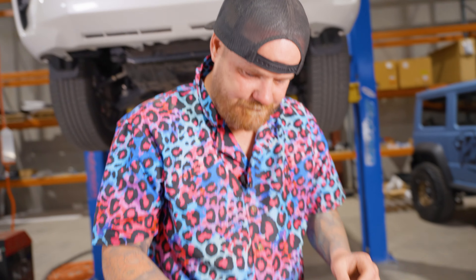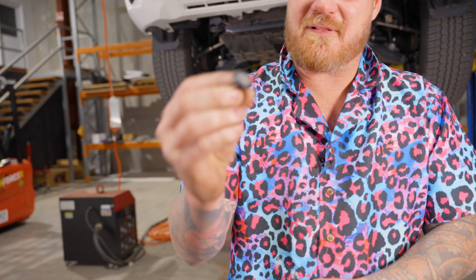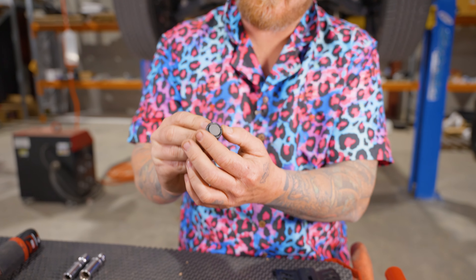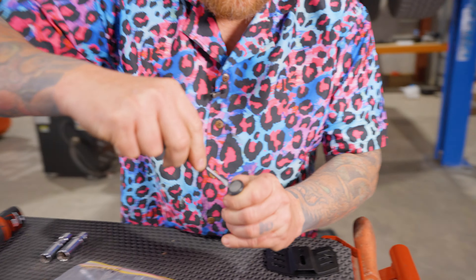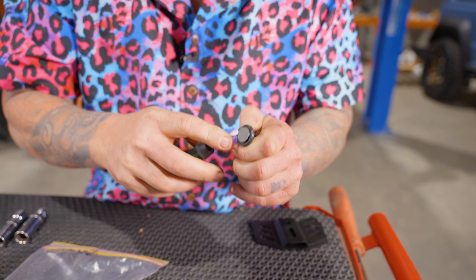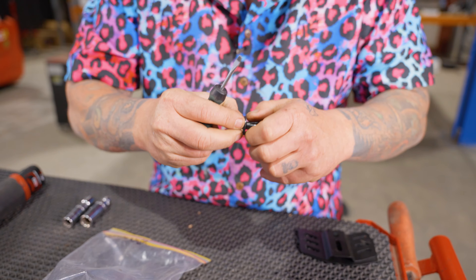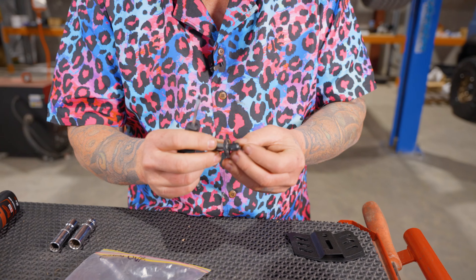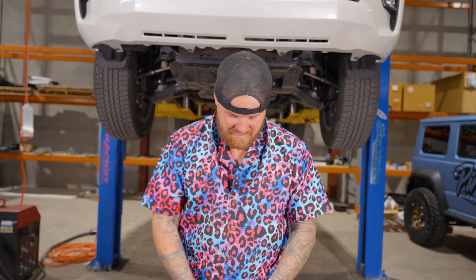The clips look like this - here's one that's not broken. They're going to be nice and flat. You're going to have to get in there and dig under them with a flat blade screwdriver. You're going to have to get under there and just work your way around it to try and pop it - it can be quite painful. You'll probably get in there with some pliers and rip it out because they're a pain. You need to get it halfway out so the mushroom will close in and you'll be able to pull that out. Not easy - they're actually a real pain to get out.